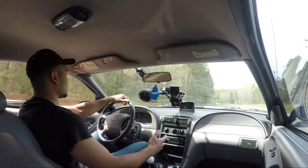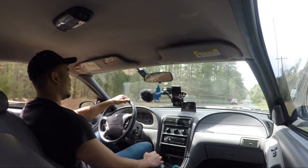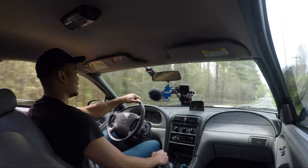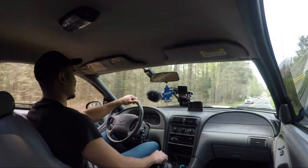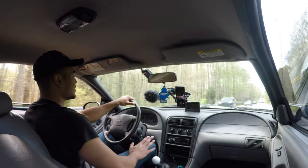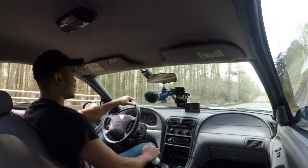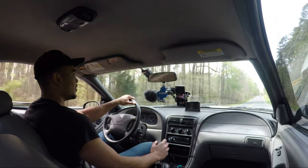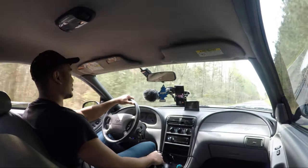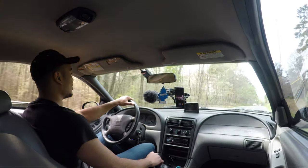The install itself took me about two days with my brother and John helping. I would suggest this be a two-person job, especially the K-member part — it's hard getting back in. Or I would suggest getting a tubular K-member because those are a lot lighter, like 40 or 50 pounds lighter, and you can install that yourself. With the stock K-member you need at least two people — actually I had three people help me because it was that heavy and cumbersome.